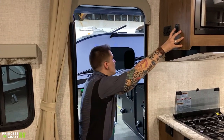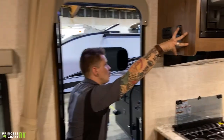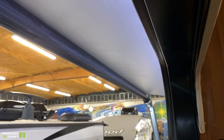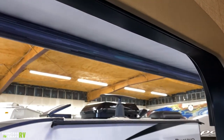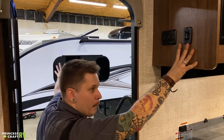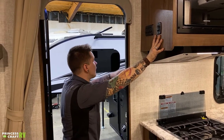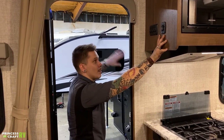Beside that we have your awning switch. This is a momentary switch, so you can choose how far you run that awning out — when you take your finger off the button, it stops. One thing you want to make sure is that the fabric is always on top of the roll. There is no brake on it, so if you hold it in the out position it will reach full out and then start rolling in backwards. If that happens, make sure you correct it so that fabric is always on top.